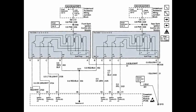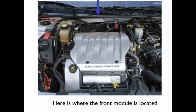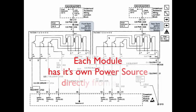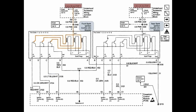We have two separate modules — one for the front bank and one for the back bank. Here's where the front module is located, right up front, and the back module is on the back bank of the engine. Each module has its own power source directly from its own fuse. The front bank has power to all the coils in the module, and the back bank has its own power supply.